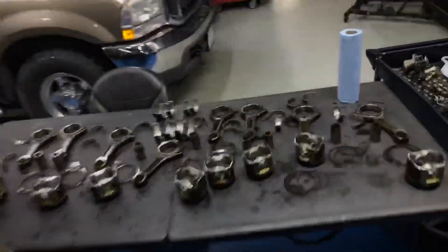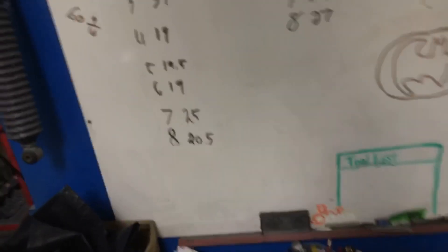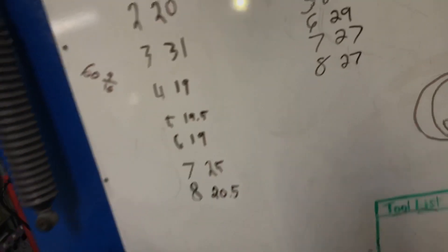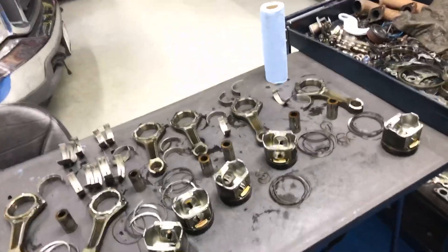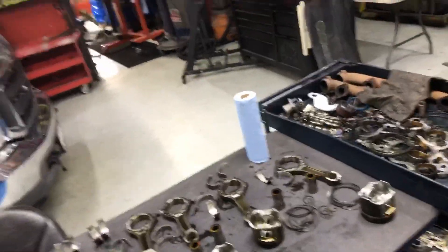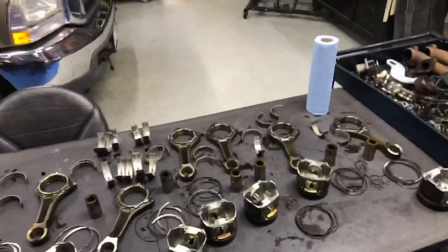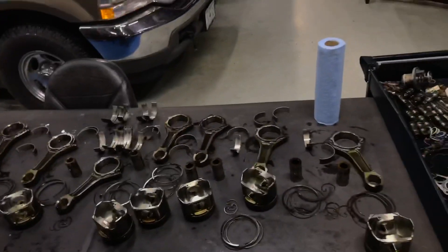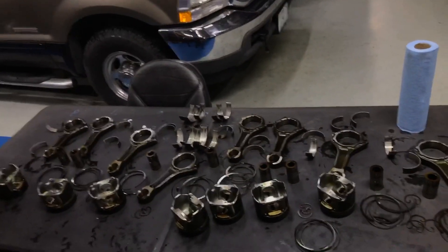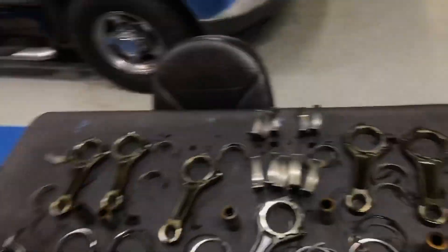That's the major factor that could change piston protrusion — rod length, or whether or not they're straight. Think about it: if you bend a rod a little bit, it shortens it. This truck — he doesn't beat on it hard but he uses it — so it's not far-fetched that all those rods got a little bend to them. He had good side clearance, actually almost too much side clearance. We're within spec but it's 22-23 thousandths on a couple of them.